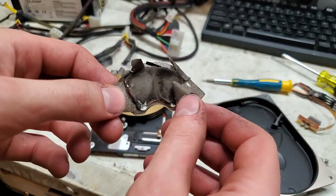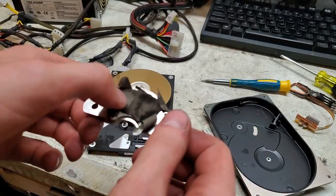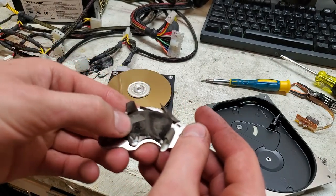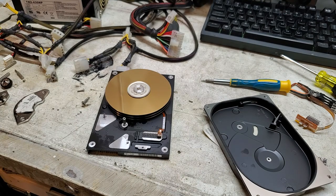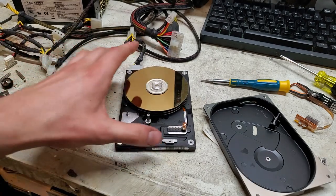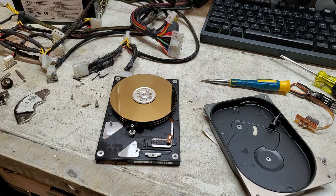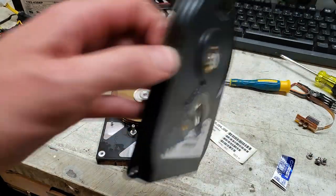I'm not sure what that is. There's no indication that anything was scraping on the surface wearing down the magnet. So I wonder if that was some sort of cost reduction or if it has some sort of purpose to it. However, that is ultimately what led to this hard drive's failure. We can no longer see the click of death because we can't get the heads to actuate. As you can see, this thing was very unhappy — it's trying to vibrate itself, trying to free the heads, because it's not getting any reading from the heads at all. So maybe it thinks that the disc platters are jammed. So I guess that was sort of an autopsy of a hard drive that arrived dead on arrival.